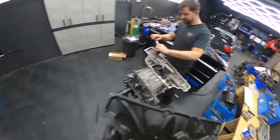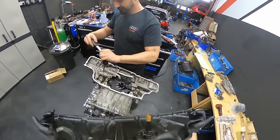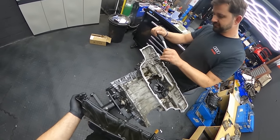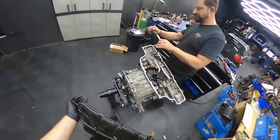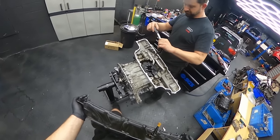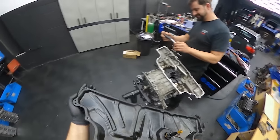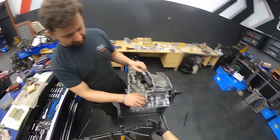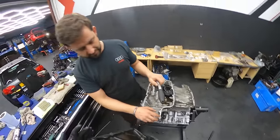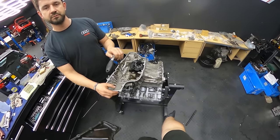Okay. So, if Miroslav will tighten these bolts, I think we can put the oil sump on because during the night, the silicone can actually dry properly. And tomorrow, we're just gonna try to finish it off. We have to take the engine from the stand afterwards and basically do the chains on the block with the cover. I can see some gears missing on there and so on. Quite a lot of things actually. And once the timing chain cover is on, you can put the cylinder heads along with the head gaskets and everything. Fun continues. I think we can put the cylinder heads on. No. Why? Because the gasket is going over the chain cover. Yeah, so we're gonna build the chains first, then the head gasket on top, flat, and then the heads.